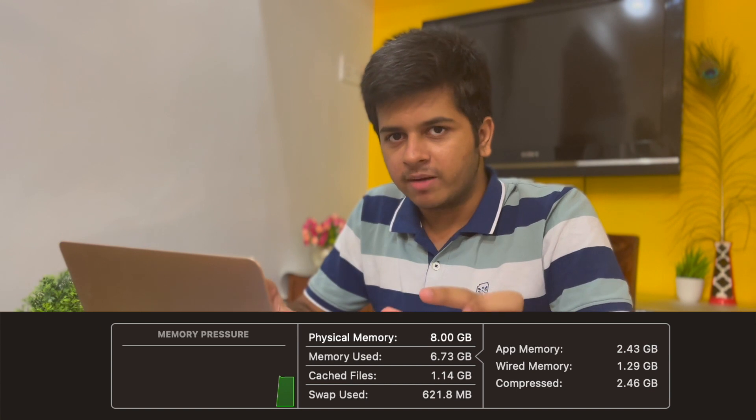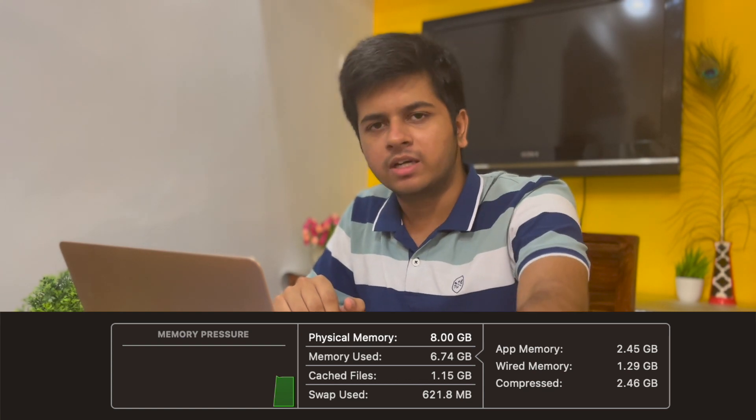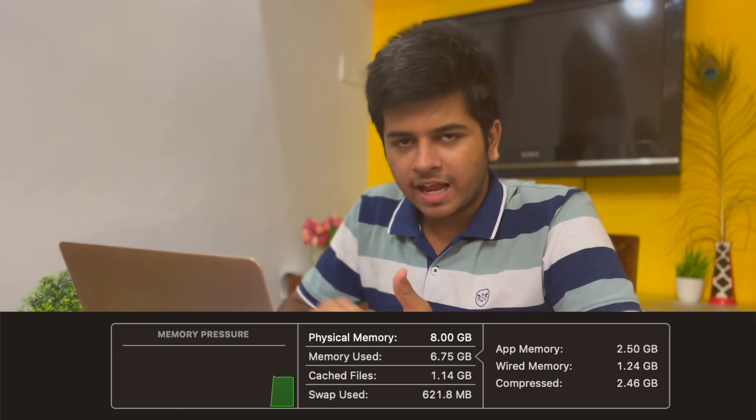The conclusion is that Apple has not used 128 GB chips — they've used a single 256 GB storage chip. Here's why this matters: the base variant of these MacBooks has 8 GB of RAM. When RAM fills up, the system starts to use swap memory — meaning it uses a portion of the internal storage as overflow.